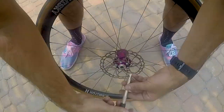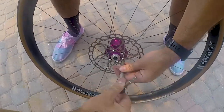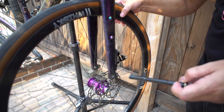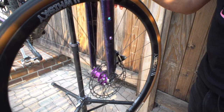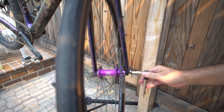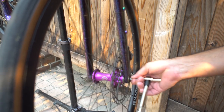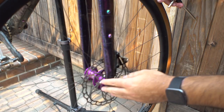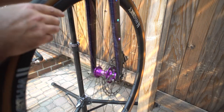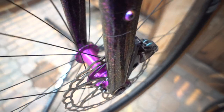This is where I really like a ratcheting tool like this Fix-It Stick — I do have a Locked In Favorite Friday review of this tool, and this is specifically where a ratcheting tool really comes in handy. After your first two shims, add the wheel back in and hope you got the number right first try. This may take a few attempts to get perfectly right — there is some trial and error for both front and rear, but the same principles apply. Make sure all bolts are fully tightened, as a loose rotor will affect the distance it sits from the hub. Spin the wheel: it's rubbing less and spinning more freely, but I think I need at least one more shim.